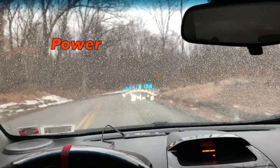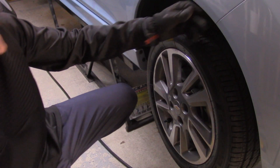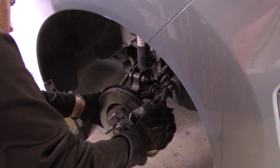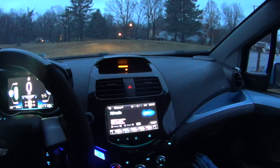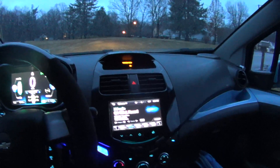It's a grown-up RC car, so power — check. You've got all four disc brakes, 10-inch rotors front and rear. The brakes feel fine out on the highway or above 30 miles an hour. But when you get to 10 miles an hour and under, the brakes are really bad — I think it's because of the pad and rotor material choice. We're going to change the pads out in a later video. It's really super touchy and off-putting at first, but you get used to it.